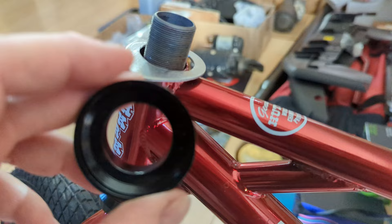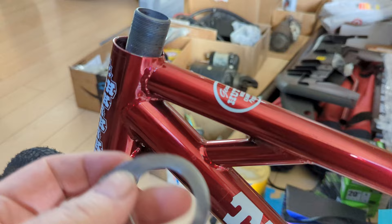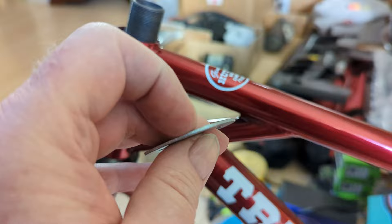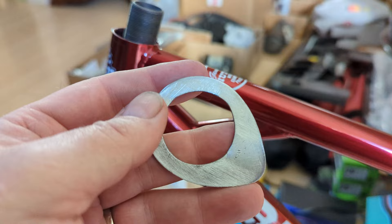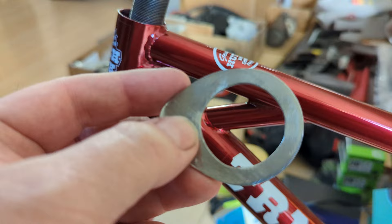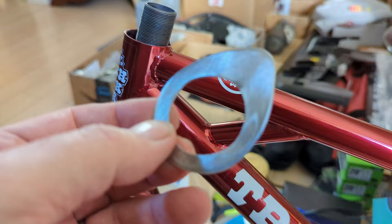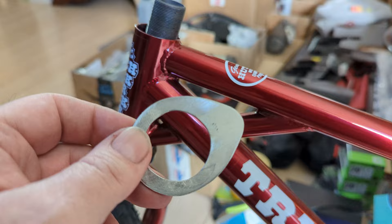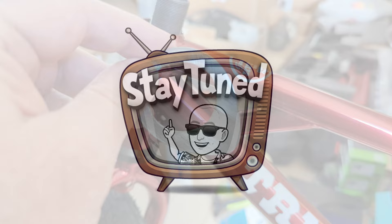Based on studying the gyro setup, I had to pull the bearing cup and make myself another piece. This one is out of eighth-inch steel - the thinner aluminum material just was not strong enough. I still need to drill a hole and tap it so I can put the cable hanger in with a bolt. Once I get that done I'll show you the finished product. It was quite humorous in hindsight - hopefully I'll get the brakes on and be able to ride before dark, so stay tuned.